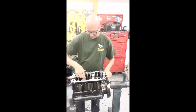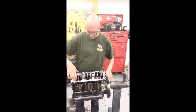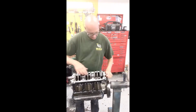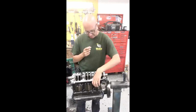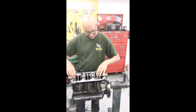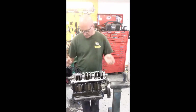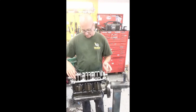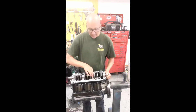These are seal rings. They divide one cylinder from another. I want you to take a moment and think about why you need them. All 2-strokes have some type of seal ring because it can't run without it. All 2-strokes with more than one piston need a seal ring between the two. You can think about it. I'm going to put the answer in the printed section of these videos.